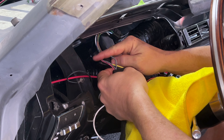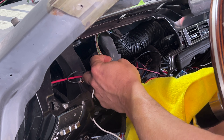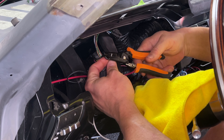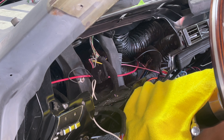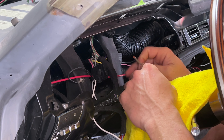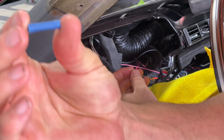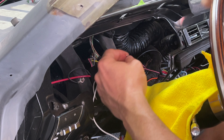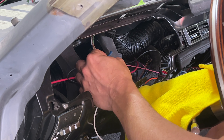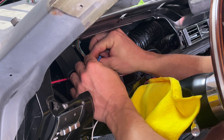This is the connector that has the wiring for the lights right here. I already cut the wire and I'm going to strip it back just a bit. I got an extra piece of wire from when I wired the lights into the dash. I'm just going to take one of these little splices — one side is going to be a single wire, and on the other side I'm going to feed the double wire in.